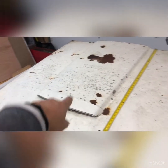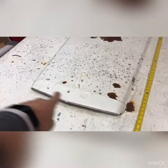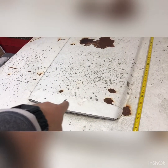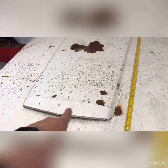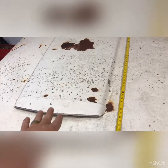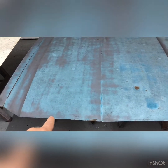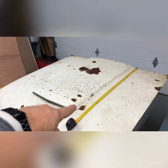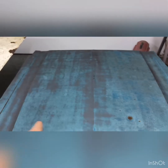Because this scoop is so long, I'm thinking about cutting it the full length of the hood and bringing this section — which is actually a separate piece — all the way to the end. The actual scoop will be almost hanging over or right at the edge of the hood. I think that'll look pretty sweet. The nice thing is it's only 24 inches wide, so I've got plenty of room side to side to cut and put that in.